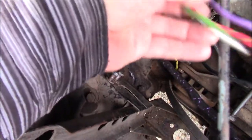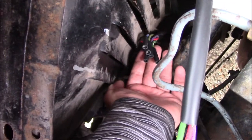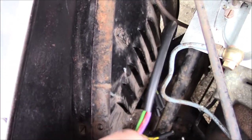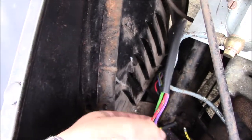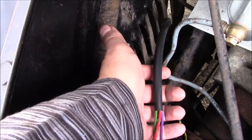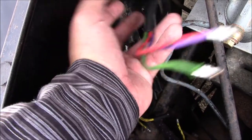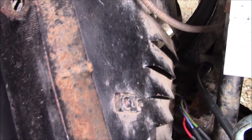This is the last run of the new wiring that's going in along the chassis, and there's two lengths that go along the chassis - you have to feed them both through at the same time. This one is in as far as it needs to go and I think this one is as well. I do know when everything's all in the chassis it's easy to move it forwards and backwards if you need to. I've stopped pulling on this one because the plastic sheath sections are usually anywhere that's outside the bodywork, and that's about where this is. This has all gone through the proper hole - rather than coming up through that triangular hole and that round hole, they both go through the round one now, which makes things a lot tidier.